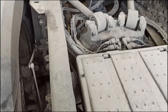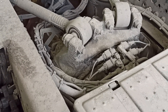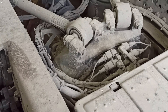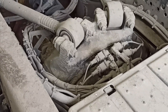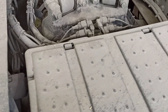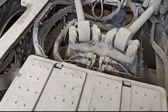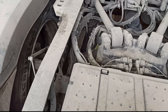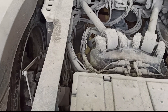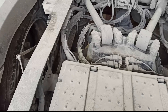Before you actually start installing a sensor into part of the air suspension system, you have to let the air out. In this case, we have four bellows on this truck that are all interconnected into their own system. So we have to let the air out, and once it's out, we can start installing the sensor.